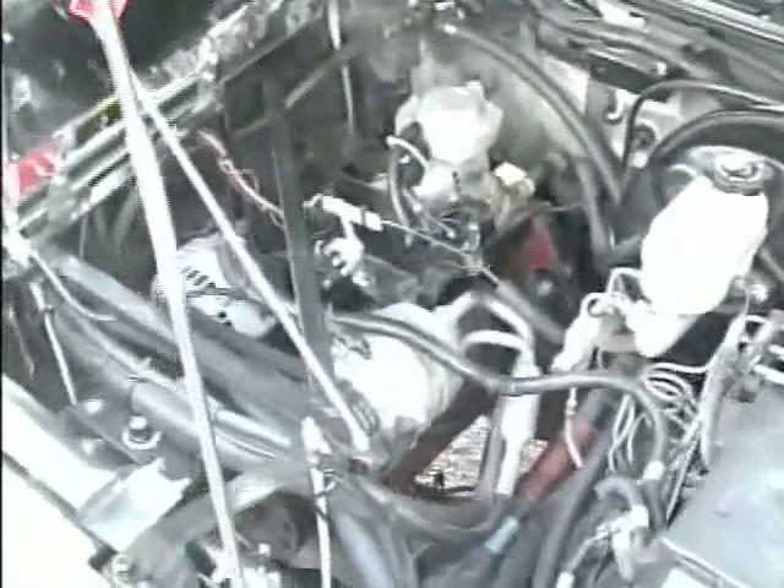We took the power steering off for the simple fact we were trying to conserve our wattage to get our mileage — and that was with lead acid batteries. Now since we've switched to lithium, we're not as concerned about it. I don't think it'll hinder the range much; we'll still get our 60 to 70 every day, and it'll be easier for the end user. We experienced a dramatic improvement when we went to lithium batteries — the discharge rate when you accelerate is the biggest thing you'll notice, besides the range. There's much less voltage sag compared to lead acid. It's just better all the way around.